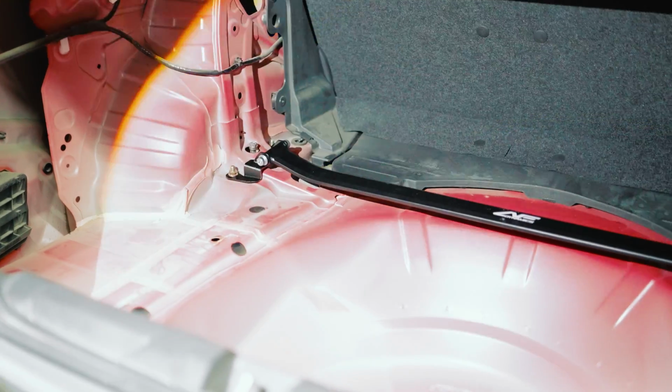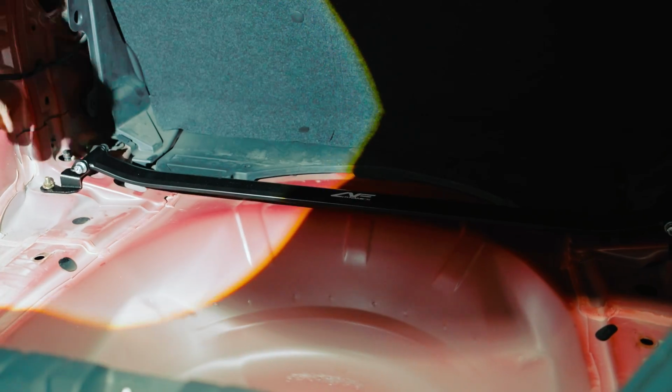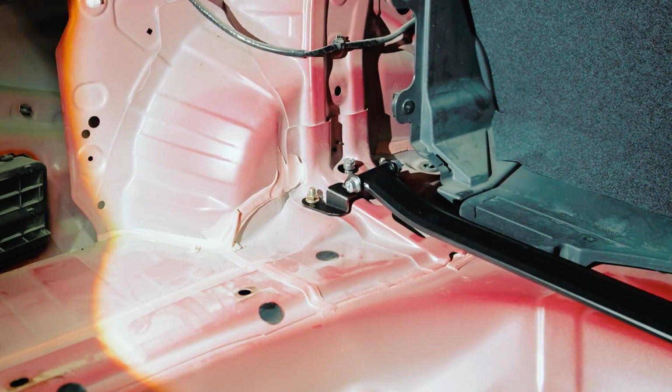Okay. I know we don't have any covers. So what we can do, guys, to be honest, if you want to show this bar, you could just put it back, right? You could trim around the bottom end of the cover. So we still gotta tighten up these 2 screws right here. So guys, for these bolts right here, for front and back, we would do about 65 foot-pounds of torque. Let's do those right now.